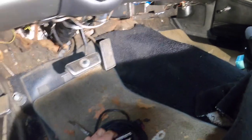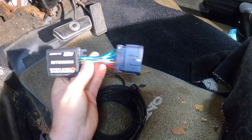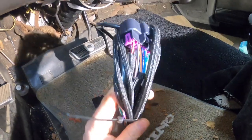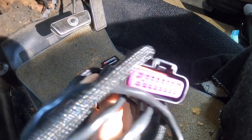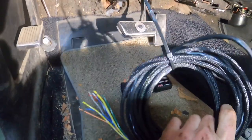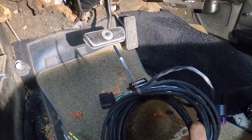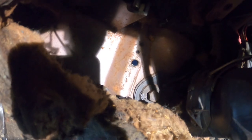Moving into the car, I need to find a spot for the controller — this is basically the brains of the operation. Here is the wiring harness that comes with it; it hooks directly up to the controller via this big computer-looking plug. It's got a few wires that need to be hooked up. The four wires that need to go underneath the car are to the solenoid and to the signal generator. I'm planning on running them through this hole here, which should be big enough.